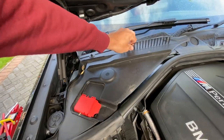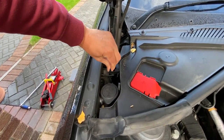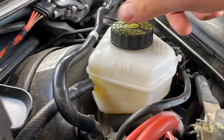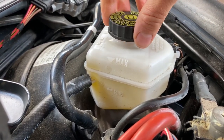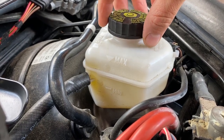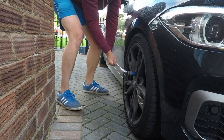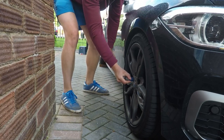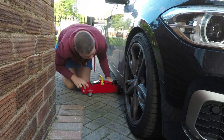There is a clip on the left-hand side which you have to squeeze to release it. Next, open the cap on the brake fluid reservoir — you need to do this to release the pressure in the system. When fitting new pads, which are obviously thicker than the old ones, you will have to push the calipers back in, and without opening the reservoir you wouldn't be able to do it.